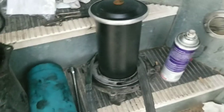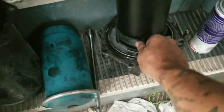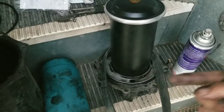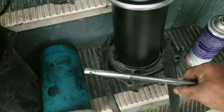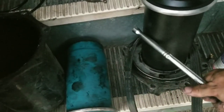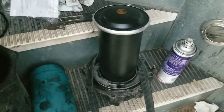I had to replace a lot of things - just two major things to make the bus run. Got the serpentine belt. I'm going to put it around here and then have it at the bottom, screwing onto that little screw right there. I'm going to put this around, take that bar, stick it in there, twist it until it's super tight. Then tighten it the other direction - clockwise. I did it by hand, I think it's good.